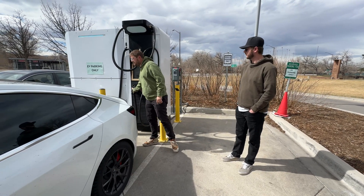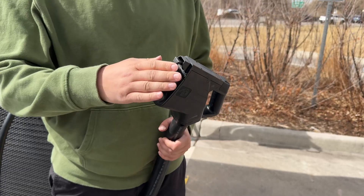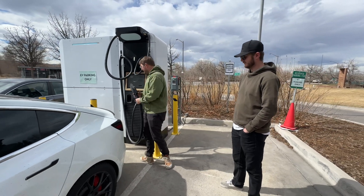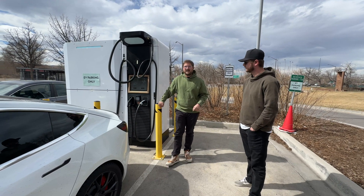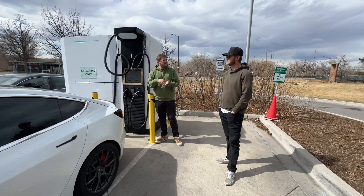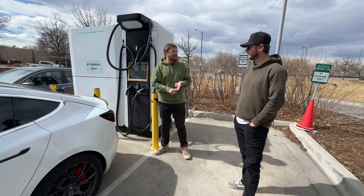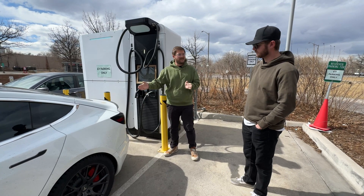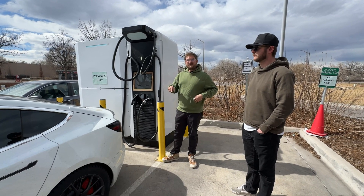Later on, CCS came out — the plug that pretty much every other electric car in the U.S. uses today. It's a relatively ugly, quite flimsy, annoying-to-use connector. No question the NACS connector is better. But with CCS becoming so popular, and because there was a lot of German involvement in the development of the standard, it's actually significantly more secure — especially with provisions on top called ISO 15118, which covers plug-and-charge and encrypted communications. As EVs become more popular, you need to think about security, data privacy, and people hacking into your car. CCS is both a plug type and a communication standard.